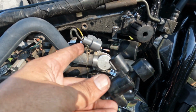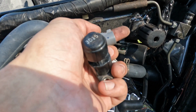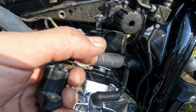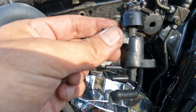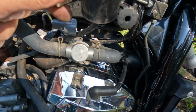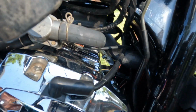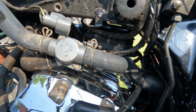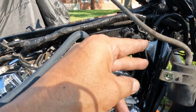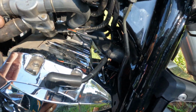All right, so that electrical clip popped out pretty easy actually. It's just a little button you push here. It's not one of them things you got to flick up, so you just push it and pull out, no problem at all. I got the screw here from in here, and now this whole mechanism here, just throw it. Don't need that either. This thing right here comes out, so you know what it looks like. That's tucked underneath, I believe that's the starter solenoid that we did the ground fix on. That's tucked under here, so if it's still under there, it still has to go. So garbage. And that is giving us more and more room to get at this stuff.